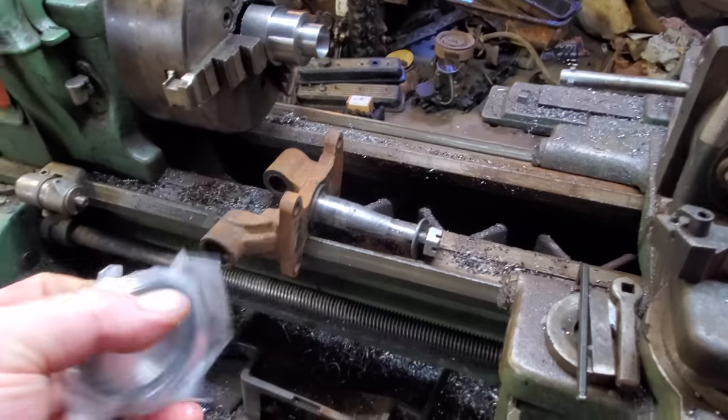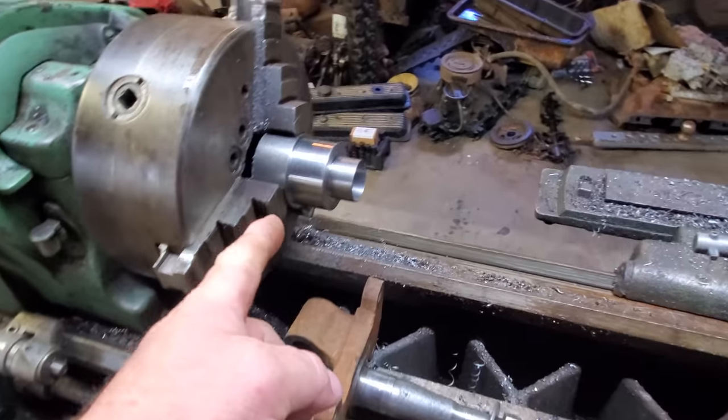They also make a 3/16th spacer after you get the rotor on — a 3/16th spacer on this end. The only reason I can think of is this is only an inch here, and they're trying to move it that way to give that thin area a little bit of support, and where the wheel mounts on this rotor it's about a half inch further out than original — they may be trying to get the track width closer to stock. So I'm going to make that 3/16th spacer too. I really wished I'd have found those instructions two weeks ago when I started planning this.